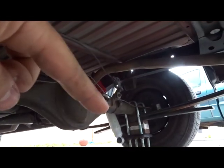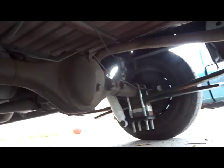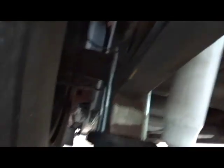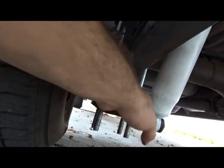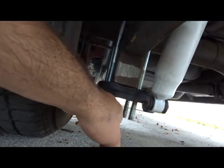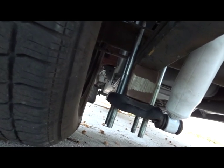The back was actually easier. For the back I put two shocks — you can see the wide one and then this one right here with the red boots. That wasn't a problem at all. The lift in the back is a three-inch block. What you do is lift the truck up, take off the stock U-bolts, keep the plate, lift the spring, put the lift block in, put the spacer and the plate back, then put the new U-bolts on and screw it all back together.